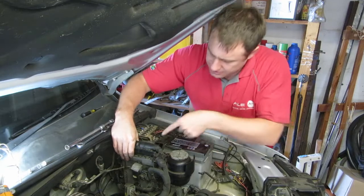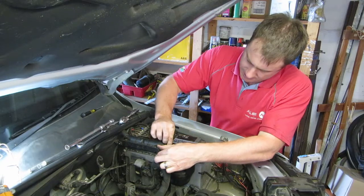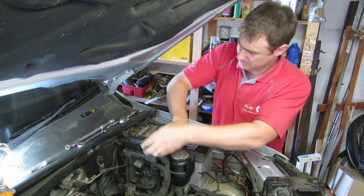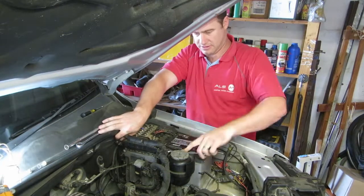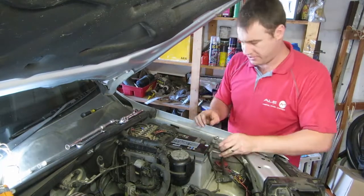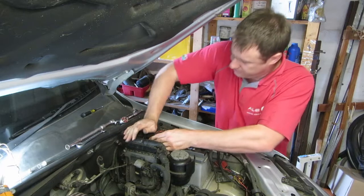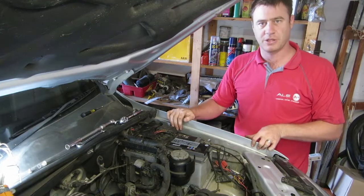After fitting the new battery, you'll see there's a little slot that the bracket slides into to put your ECU back in place. Put it in the correct position and tighten the two bolts. Two nice pushes on the sides and the cover is locked in place — and that's it, your new battery is in. Cheers!